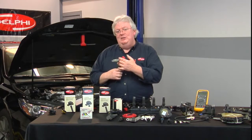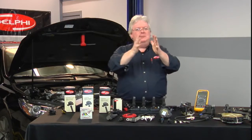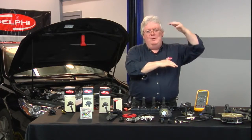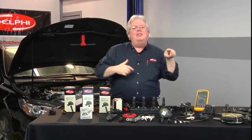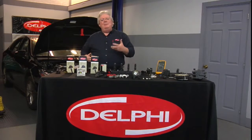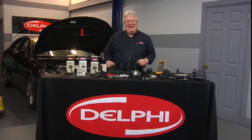You know which one number one is, so with a firing order you can simply look at all the patterns at once. Span the time out on your scope — left to right is time, up and down is always either volts or amps — and look at those signatures of those current ramp-ups of those coil events. When you find one that looks radically different than the others, that's the one that's intermittently breaking down, and that's the one you have to address with new parts or at least some further diagnostics.